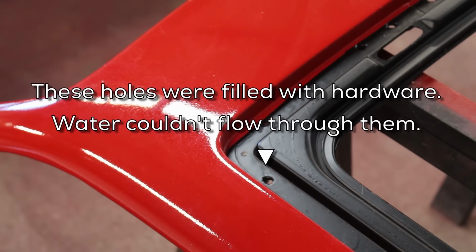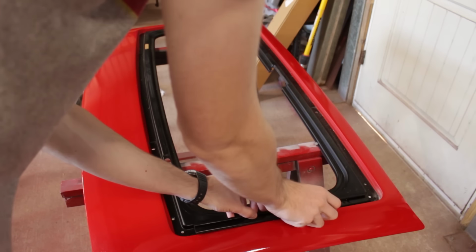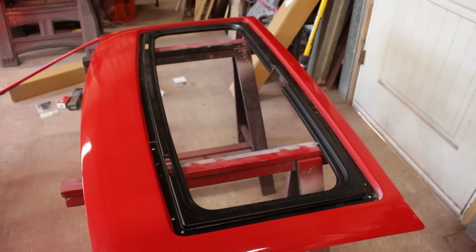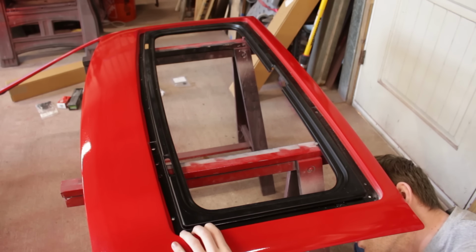These new tracks sandwich the roof down to the chassis by threading in some bolts from the inside through to here. Besides being attached to the chassis with the bolts alone, they're also attached to the roof panel directly with the rivets. And here is where I promptly decided to not read the installation instructions for the sunroof tracks.